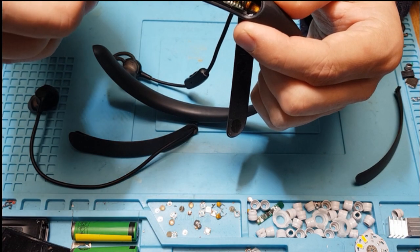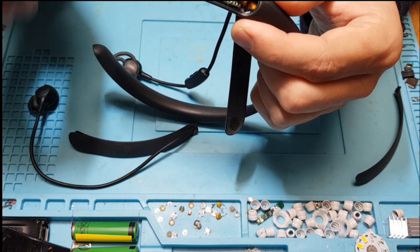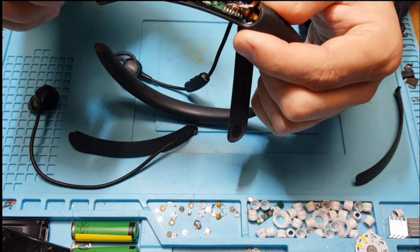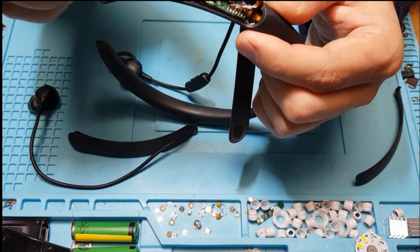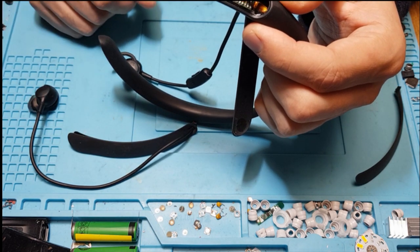For the plastic pins, what I did was squeeze them with pliers and left the original ones intact. Then I heated my soldering iron to around 100 degrees or a little less and was able to push in the plastic to hold the PCB in place.